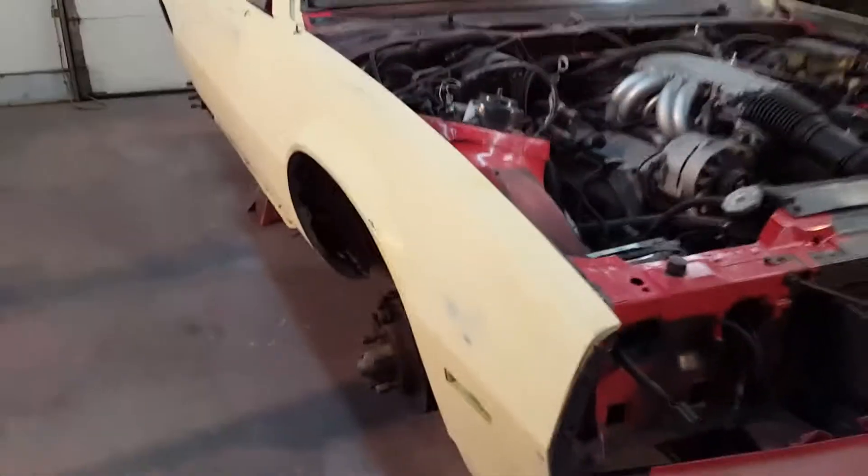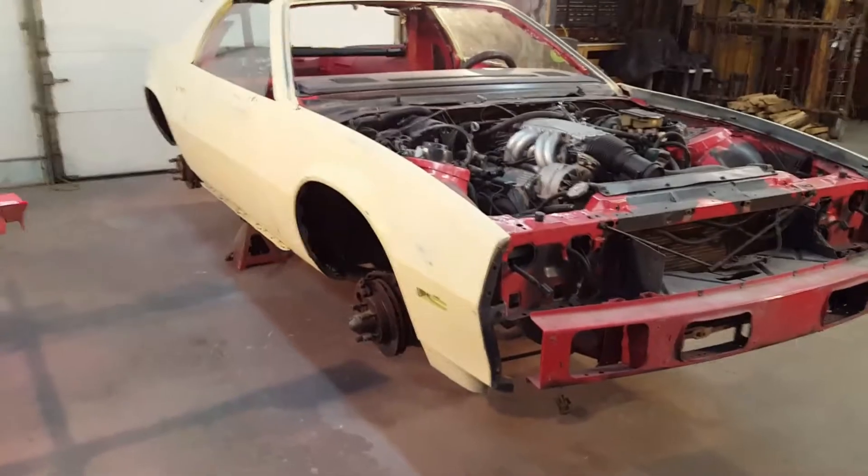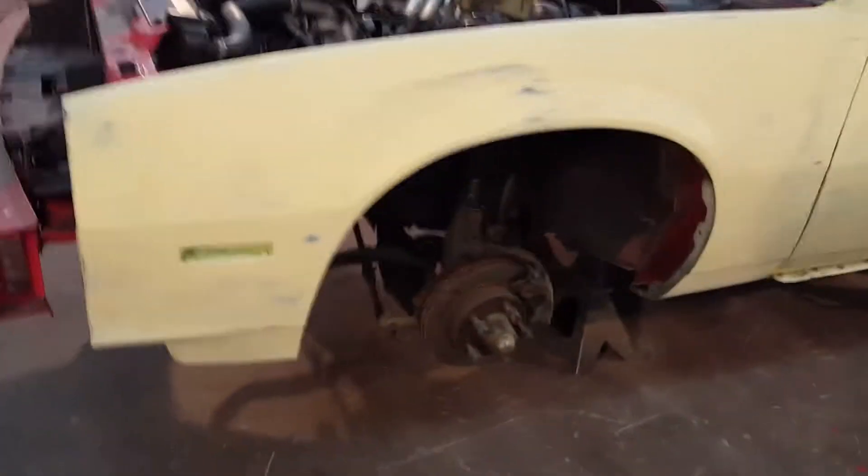The rest of the car is all block sanded. I'm going to start masking it this morning — it's five in the morning right now. We started a little bit yesterday before we painted these parts, went around taping off some of the holes, and I started back-masking some of the door jams to get my tape line going. Then we'll start adding the paper.